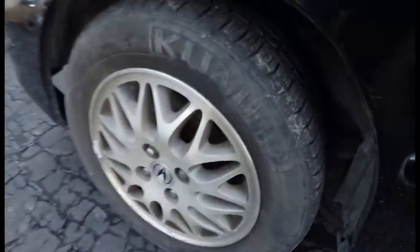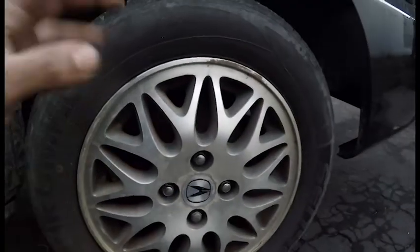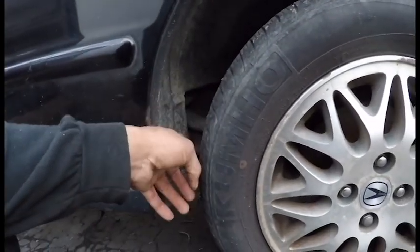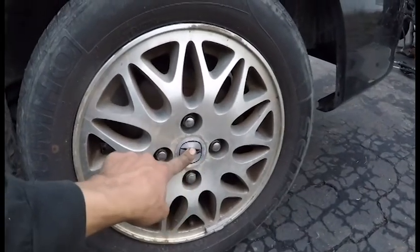In the back, I'm actually going to retain the Integra trailing arm. And we're going to use a Nissan Maxima wheel bearing. The lug pattern is the same, 5x114.3. It should bolt on with a little bit of work to the back wheel. And that gives me my factory rear trailing arm with 5 lug in the back, and most importantly, a very large axle.